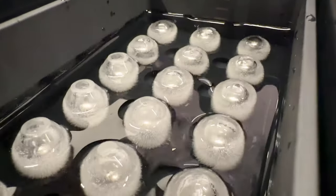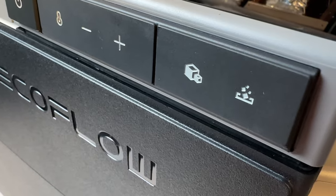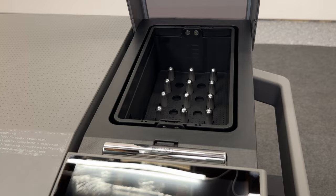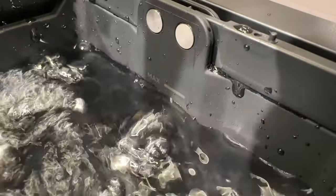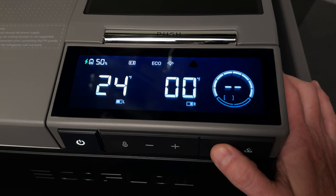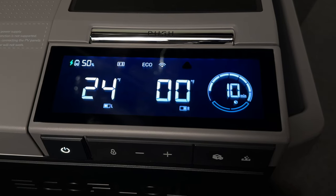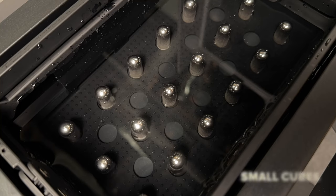The ice maker is a very innovative feature — it can make a tray of 18 tube-shaped ice cubes in less than 15 minutes. To make ice, first you fill the reservoir with cold water to the max line, which uses about 44 ounces or 1.3 liters, and you can make four trays before needing to top it off. To start the ice maker you just press the ice button; press it a second time to toggle between small and large sized ice cubes. After five seconds it starts making ice and shows a countdown timer that varies based on temperature and ice cube size.